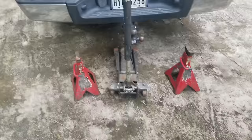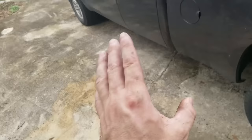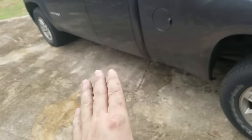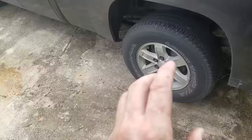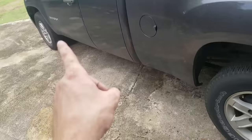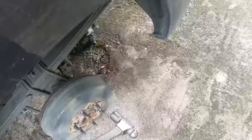I'm going to jack up the truck and check the brake system front and rear. His concern was the rears. When brake fluid is low it's generally the front brakes wearing out first, so I'll look at the whole system. To look at brakes on these you've got to pull the wheels and tires off and the drums off. A tip for drums: a lot of times you have to go through the adjuster in the back to loosen the shoes enough for the drum to clear. A trusty hammer and keep hitting it will loosen it up.